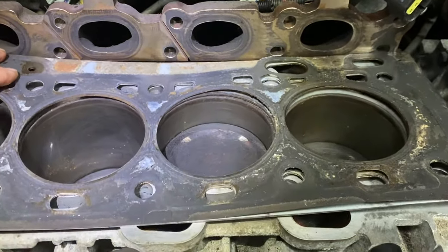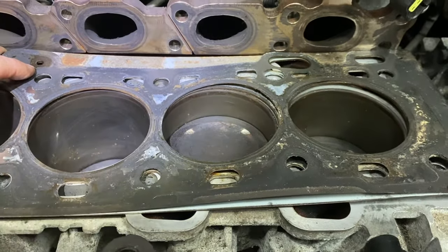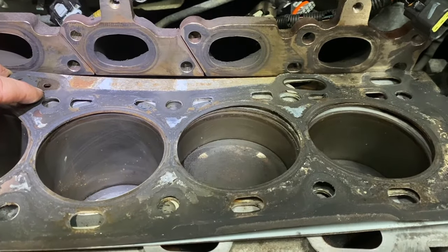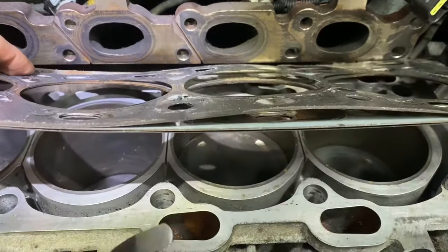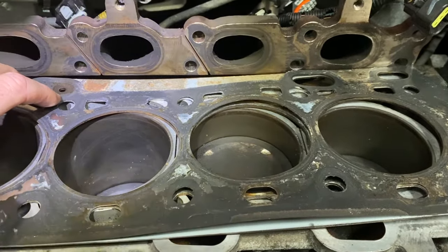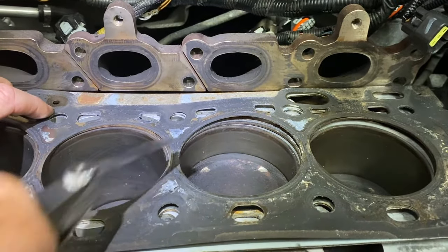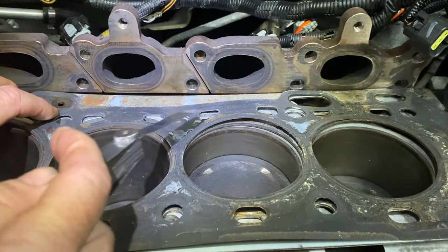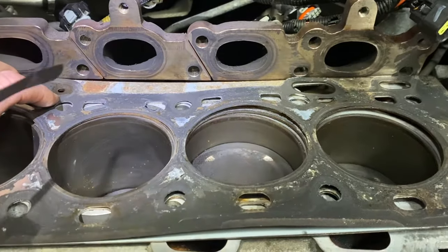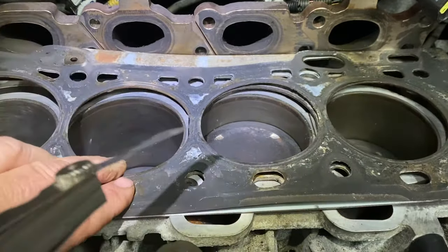Now this miracle liquid they're selling — when a head gasket blows, the number one reason is that the cylinder head is most likely warped, or the cylinder block if it's aluminum like a lot of new cars. They want you to think that the sealer is gonna seal the combustion chamber, the cooling area, the oil passages, or whatever is going wrong — just by following the steps on their bottle of miracle fluid, which is crap.